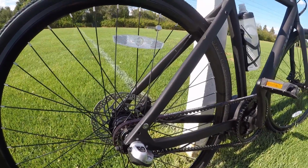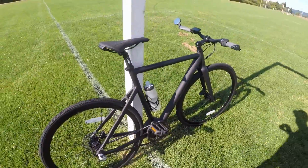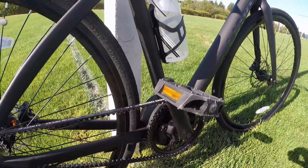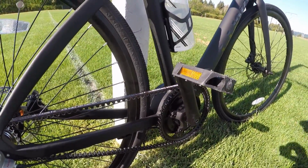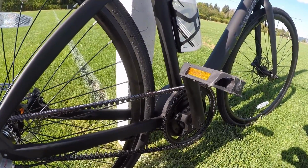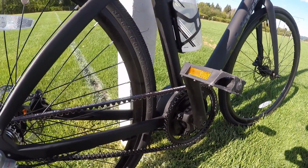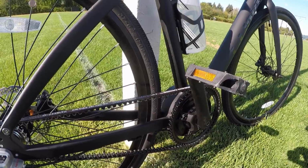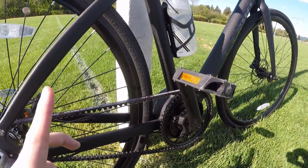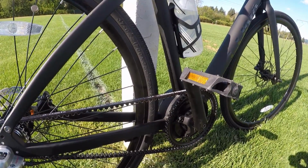Now I'm going to link in the description, I've been on with Luna Support, there is actually an app to check the belt tension by Gates. Gates, the company that makes this belt drive system, has an app where you hold your cell phone with the app open, you flick the belt, and the noise it makes will tell you how tight it is and if it needs tightening or loosening. Now I haven't played with that yet. I only found out about that this morning from Luna Support, but I'll leave a link in the description. If you own this bike and you want to check the tension on the belt drive, go ahead and give that app a shot. It looked pretty awesome. I'm excited to tinker with it.